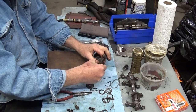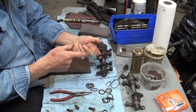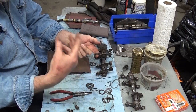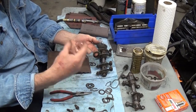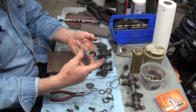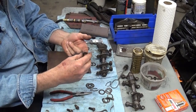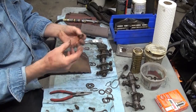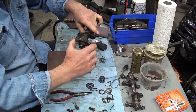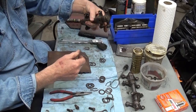So you always got two flat washers and a wave washer in the middle, and keep in mind you always have three, just like on the flywheel shims that are back there. Those aren't just shims to keep the distance. Those things are turning and have oil in them, and just like these do, they're supposed to be that way to make up clearance and eliminate heat and problems. So okay, you got your three off. Now there's no pressure on here. This doesn't even want to turn.